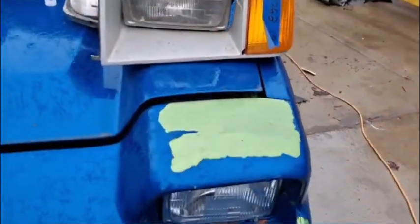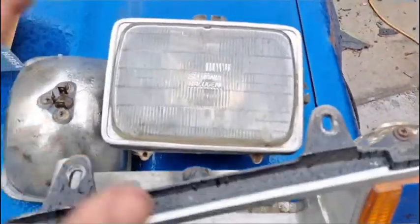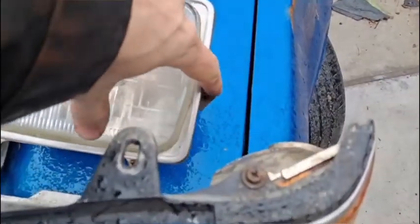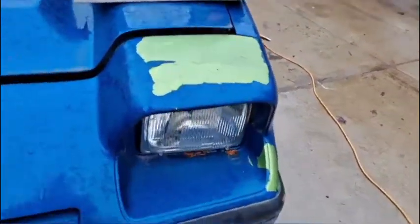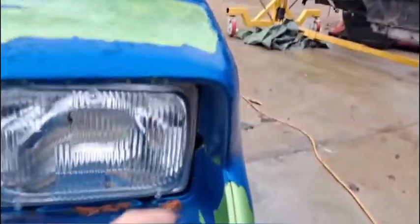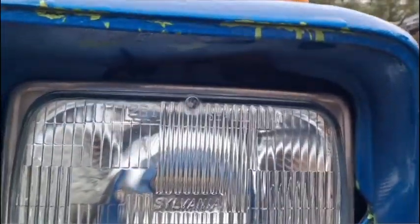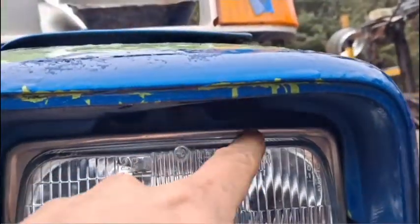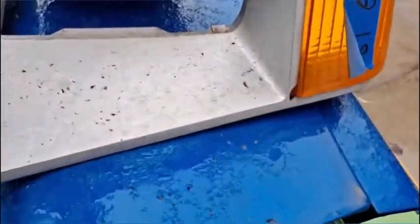I'm going to focus on these Escort ones because the EXP ones are kind of tricky to show since they're in those recessed buckets. If we take our Escort one and tip it backwards — normally these are mounted on the car with a screw and a spring here, a screw and a spring here, and that's what allows it to pivot within the car. The EXP is the same exact setup. There's a cutout so you can reach that screw, just like on the Escort bezel, and a big opening above to get to the adjustment screw and the lens bezel screws, with two more bezel screws down below.